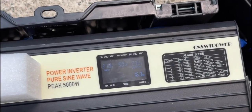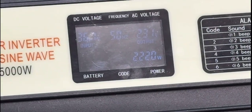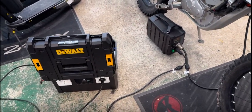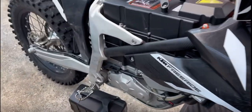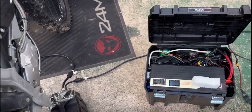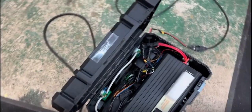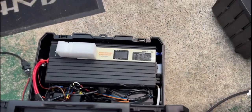The fan kicked on on the charger too. Something clicked on the bike — it's ramping up power. The good thing about the charger is that it ramps up power rather than full blasting. We're at 2.2 kilowatts — it's doing it all by itself. I can basically take this with me and charge the bike out on the trails. The battery on this bike is about 3.8 kilowatt-hours total, usable around 3.2, so it's basically a full charge — which is kind of cool.